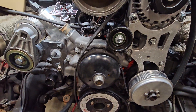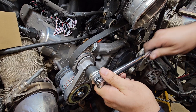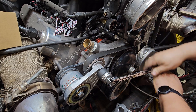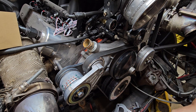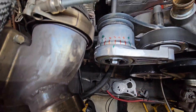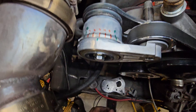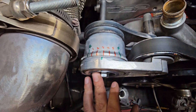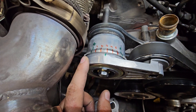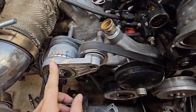I'll go ahead and put the belt on so you can kind of see what it looks like. All right, through some magic here — got my belt on. So when you do this, a couple of things to note: you can see the tensioner sitting at roughly almost position three on here. These markings are roughly 12 degrees apart, but that doesn't have to be precise — it's just for reference. So about position three. We started at rest, which is all the way — and we don't want to get there. It's sitting about at three, and this is a stock length belt.